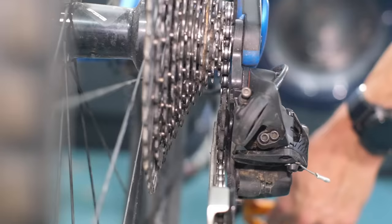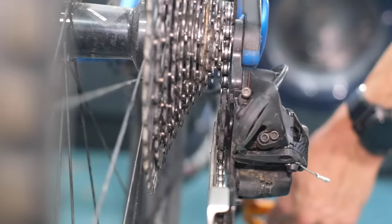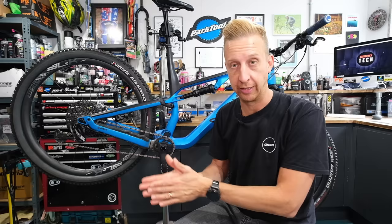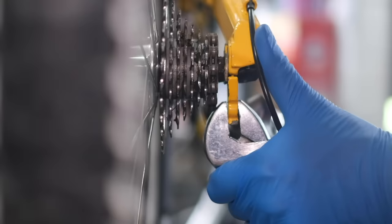Using a line of sight, look at the derailleur and make sure it hangs completely vertically underneath the small sprocket — it's really important it's straight. Note that if your derailleur is an old one that's been bashed, the lower cage could be a bit bent. Pay attention to the hanger that the derailleur bolts to on the bike — that could also be bent. If any of those things are a problem, you will need to tackle that because you won't get clean shifting if it's not aligned. To make that adjustment, there are a few specific tools, but you can get away with using an adjustable spanner. If you want to see that done, the shed bike video in the description shows how to manipulate a bent derailleur by hand and get it working perfectly.